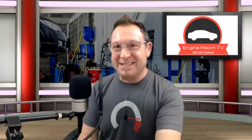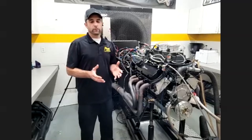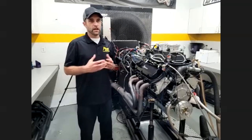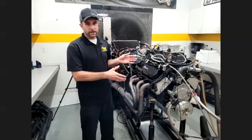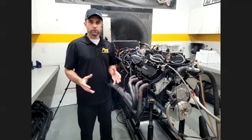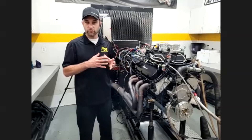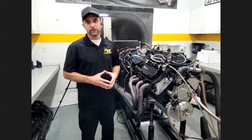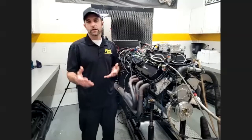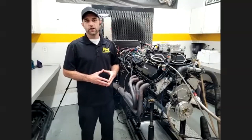One of the things to keep in the back of your mind is some people say rich is safe, and I'm not going to deny that statement, but we baseline every engine just like we did this one. We baseline it and see what kind of maximum power at what air-fuel ratio and timing. Typically whatever the engine likes naturally aspirated for air-fuel ratio, it's going to like pretty much the same thing on the nitrous. So the statement of rich is safe does apply, but we could be leaving some on the table. The real power is made as you start to lean it out, but you don't want to go too far.